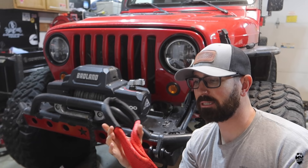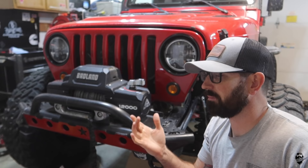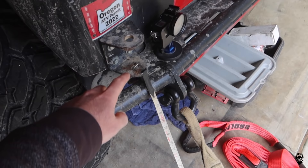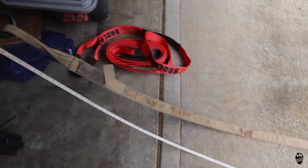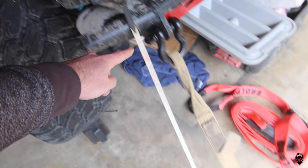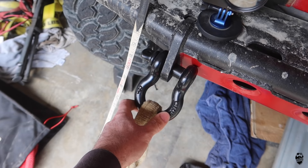I'm going to do a very basic test — it's not going to be 100% how much they would stretch in real life during a full pull. I'm just going to stretch them out with my two vehicles. The Jeep weighs about 4,500 pounds and the Montero weighs about 4,700 pounds. I'll stretch it until it starts moving the Jeep and then we'll do some measuring. The setup has a set point for my tape measure so I can measure consistently. I'm also using all steel shackles to leave the stretch factor of soft shackles out of the equation.